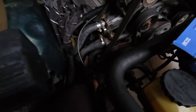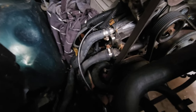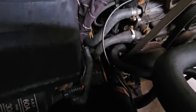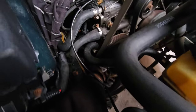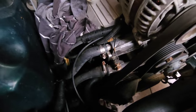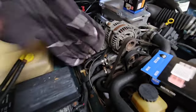Righto, all clean, all ready to go on. The main reason why you clean up that oil filter housing, and I've seen it happen before, is that you get a lot of dirt and debris in around the filter on the housing. When you screw this filter back up to the motor, you'll screw all that dirt and grime onto the thread, or onto the rubber seal, I should say. And when it screws down onto the housing, all those little bits of grime and even sticks and hay and whatnot will make that oil filter leak. It won't give it a proper seal.